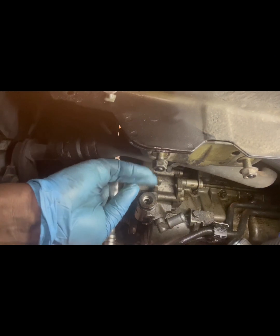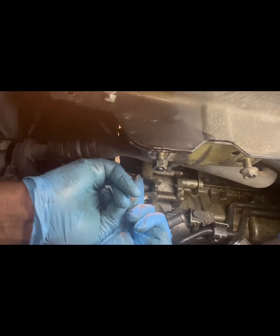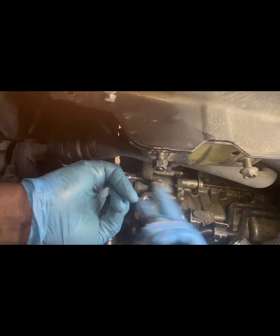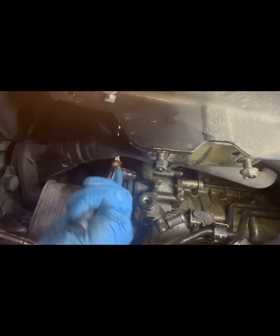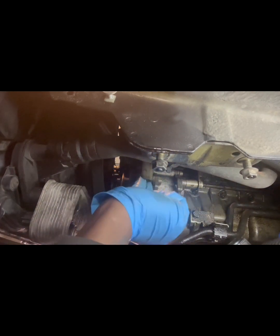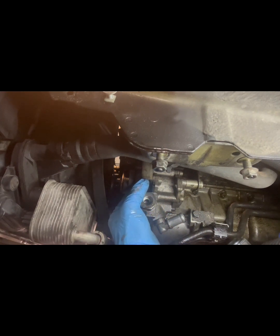Okay, now we're gonna get this power steering pump off. You got 3 hex. No, you got 3 stars. I'm sorry, on the front and 2 on the back. We'll start with this one first. I wonder if I can just get them started and take them out by hand. Feels like I can. All right, cool. They're just pretty much hand tightened.